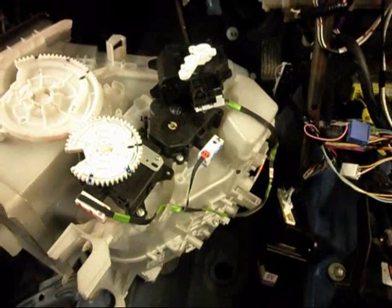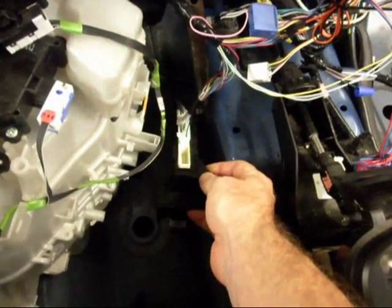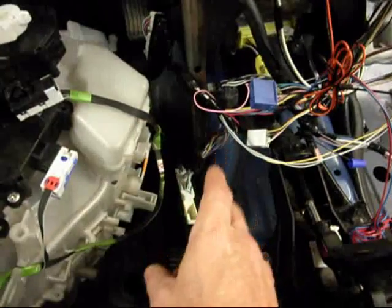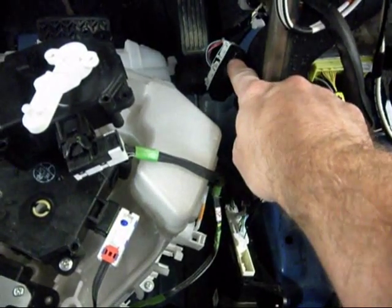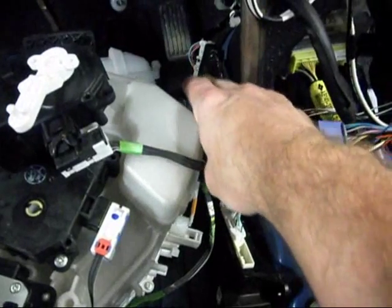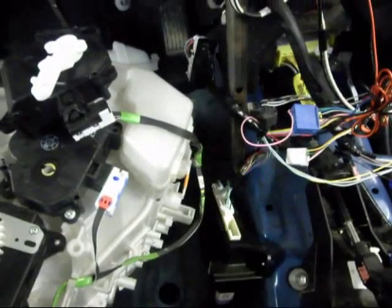I had to make a harness to allow the AC ECU. Right now I have the Japanese AC ECU sitting on the floor here. The connector E11 versus connectors E8 and E9 on the USDM one requires some conversion. I've taken the female connectors off a USDM AC ECU and basically made a plug-and-play harness that brings us from those two connectors to connector E11 on the Japanese one, making it much easier to install.